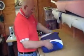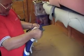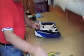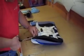Right, I tend to now go to the front corner. Again, just pull it quite tightly. You can see that's now pulling out the creases. Okay. Again, get your gun ready. If there's any excess fabric like the original there, you can, if you want, just cut that out. That gives you a little bit less thickness for the staples to fire through.